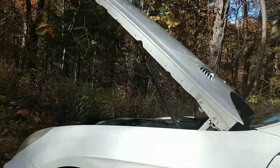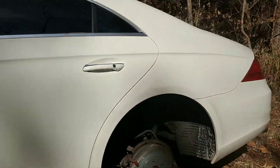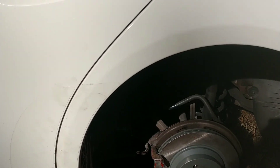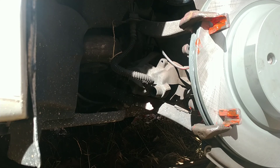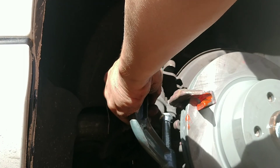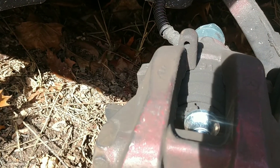The next step is to compress the piston. I had the hood open and opened up the cap to the brake fluid so any back pressure won't bust the caliper - it can just push back. If you do it slow it should go without leaking. I do have a brake compressor tool, but my favorite thing is this big C-clamp. I'm going to compress it nice and slow.